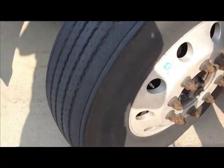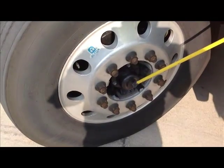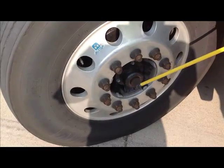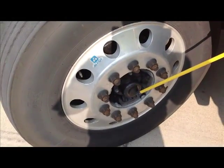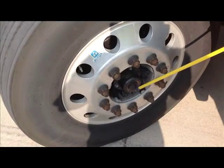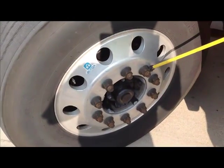Now we're working our way out, and I'm going to start right here with this outer hub seal. It is securely mounted, not cracked or broken. No missing nuts or bolts. And it has a cap on it, so we have to say that it's filled to the proper operating level. And if they ask you, you tell them we would check that by sticking your finger in there and making sure there's oil. Okay? We have our lug nuts, which are these big nuts out here.